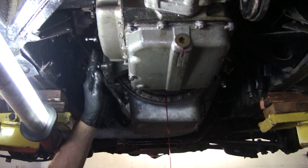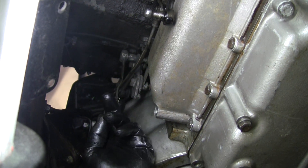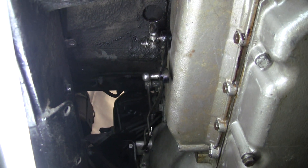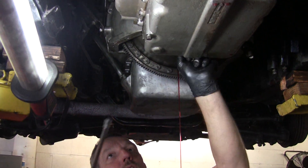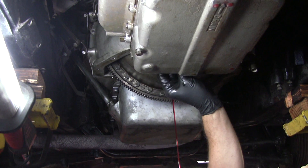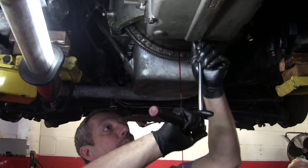While I'm doing this — if you can get your camera up there — what you're going to see is this is the throttle valve linkage, which hooks up to the gas pedal. You can see there's a bunch of play in it. He's getting like a quarter throttle before it even starts to move this thing back here. That's your throttle valve — the part of the control valve that tells it how much load you have on the engine. Is that play because it's wearing? Yeah, usually. You would have to take the linkage apart and re-bush it or engineer something to take that play out.